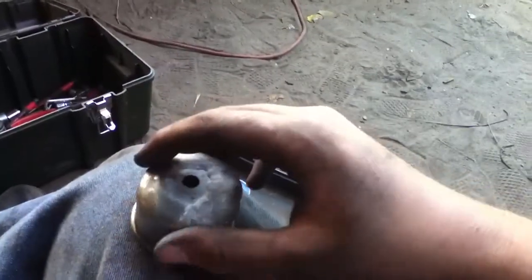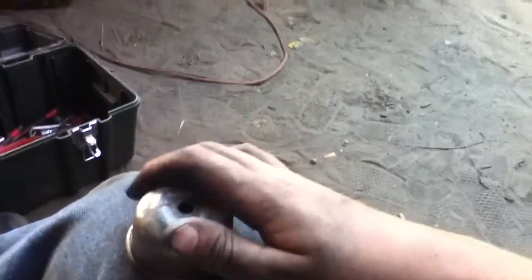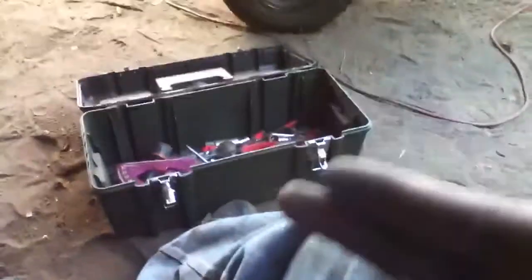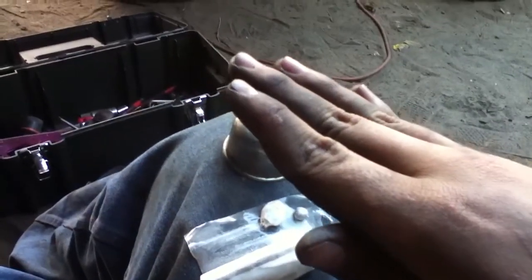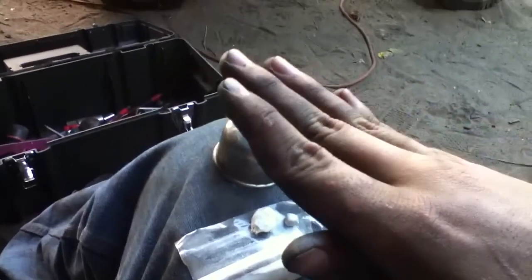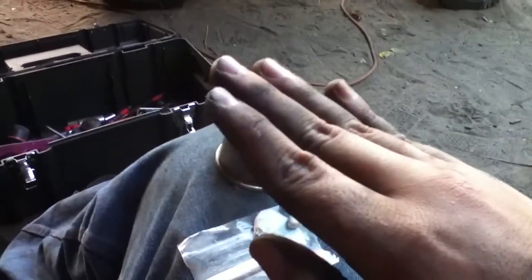I'm gonna be up all night working on the engine, tearing it apart, rebuilding it. I'm gonna take, hopefully, a hammer to the side of the frame to notch it. I don't like cutting holes or slots in the frame. I like to notch them with hammers, so it leaves the metal there, so it gives you a little leeway before it either starts going up or down. Depends on how you tuck it.